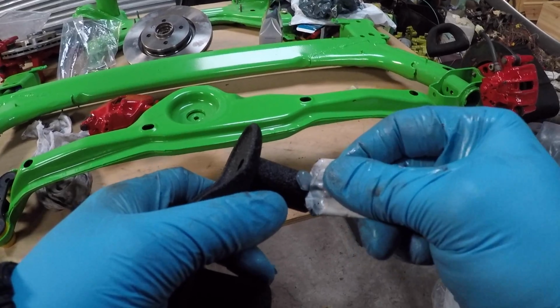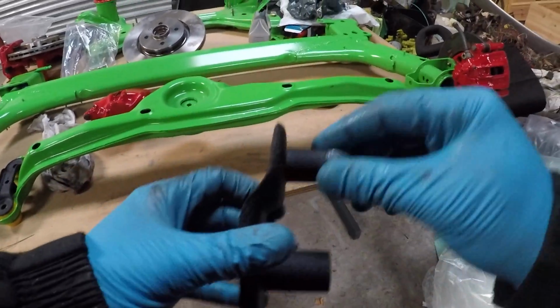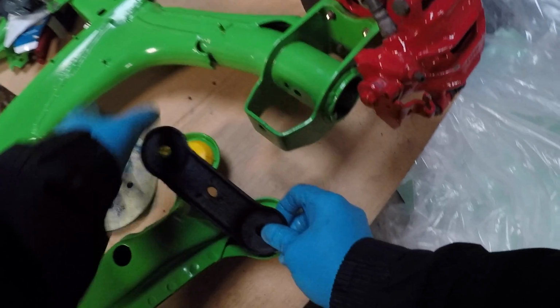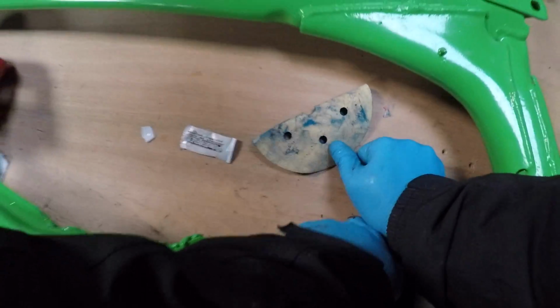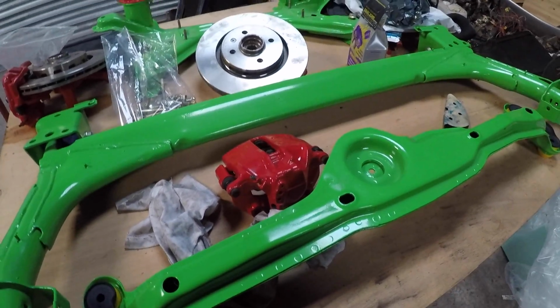The brakes I'm using are 280mm fronts, so G60 calipers, and then the standard rear calipers are off a Mark III Golf, and the discs are standard Mark II. I've had to upgrade to Brembo discs because I've had a set of performance ones. Over time they started cracking. Someone told me that Brembo were the best solid disc. You can pay to have them grooved, and that's probably your best solution. But we'll get there when we get there. I really want to upgrade the brakes to a 4-pot really, but the budget doesn't allow at the moment.